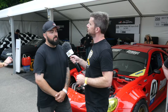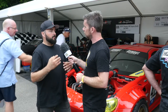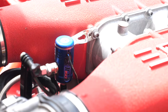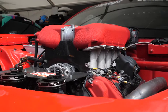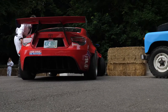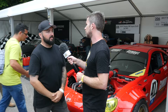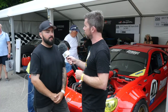Now just coming back to the power level of the engine — again we've mentioned 4.5 litre V8, not the most powerful engine in the world — and you have added nitrous to the engine. Can you talk us through that nitrous system? Being a five-speed, the torque band of the engine was fairly narrow. He'd find himself in a position on the engine where it wouldn't want to blow the tires off so easily, so we decided to fit a nitrous kit just to fill the middle of the engine — to make it feel like it has more torque or add the torque we needed in some places. We ran it to the top but it makes such good power from seven to nine that we didn't really need it there. So you could refer to it as anti-lag for a naturally aspirated engine? Sure, we put it in for the spool even though it doesn't have a turbo — just made it feel fuller.